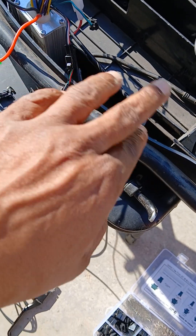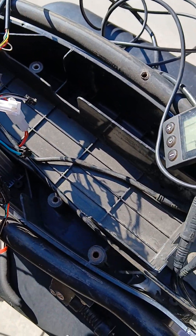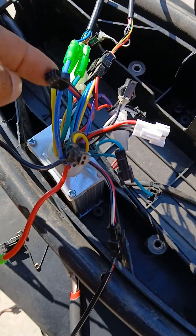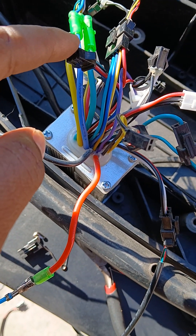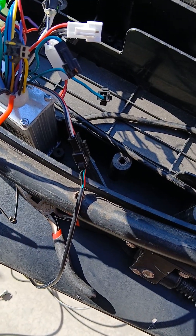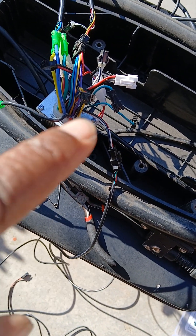One is like full throttle, and the other is power assist. So originally, I had the throttle plugged into this one — because it plugged right in and the wires matched up. Black, red, blue matched black, red, green — that was what it needed, right? Wrong.